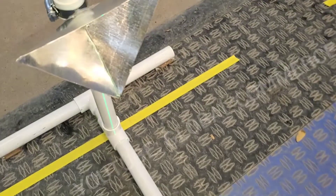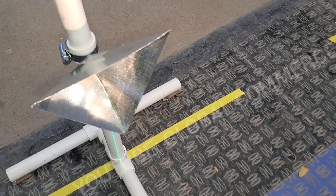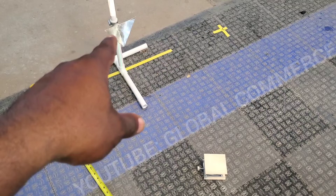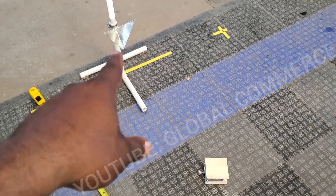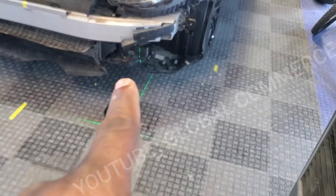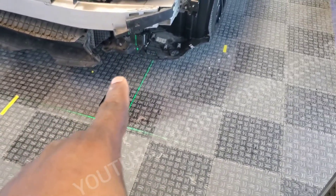Now the center point of my target, my radar — as you can see it goes drop dead center in my target as well. The important thing in doing this is centering your target and not necessarily your stand. Your target is what the system is going to be looking at and it needs to be dead center, aligned with your radar and not your stand necessarily. Your stand is for positioning and your target is what needs to be on point.